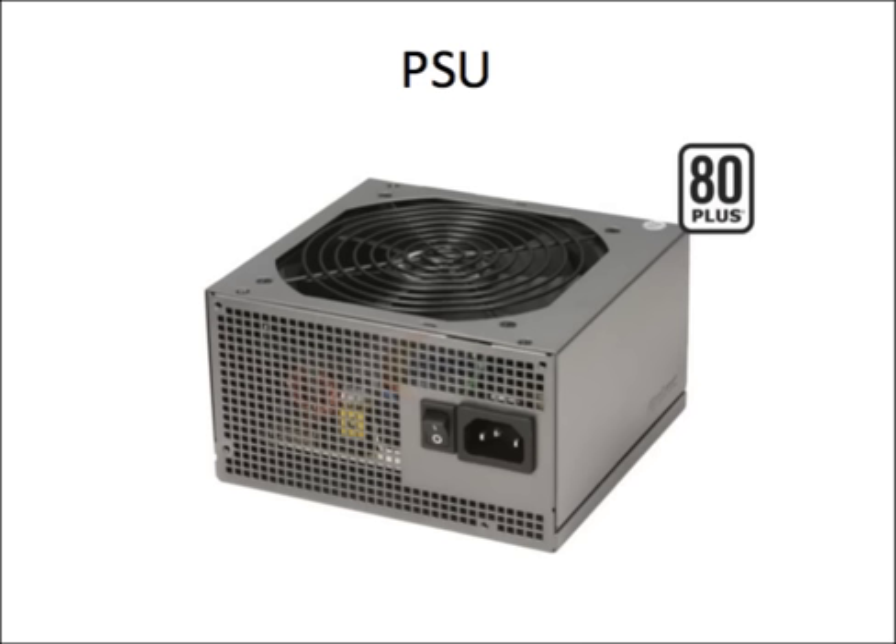For the PSU, you have to get a good power supply. Don't cheap out on a $29 Cooler Master just because it has 700 watts — you need to go 80 Plus certified. This PSU is the Antec NeoEco at 520 watts, which is more than enough to power the 7850, the i5, the RAM, and the hard drive. It's compact, well-performing, and quiet.